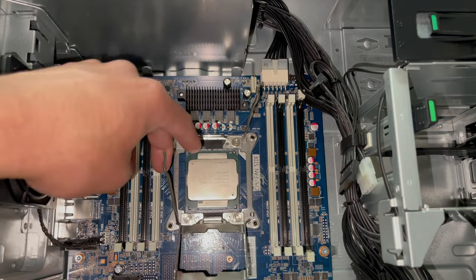So let's go ahead and get started with pulling these PCI cables out. Now with the 700 watt model, I'm not sure about the 500 watt model, but the 700 watt model comes with two PCIe 6-pin cables. We're going to be needing one 8-pin, so we're going to be using an adapter with this. And here is our adapter piece right here, dual 6-pin to 8-pin. All right.